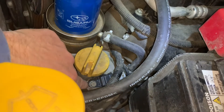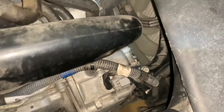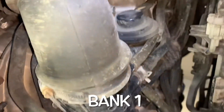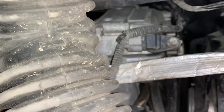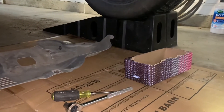The first one you'll find is on the driver's side near your oil filler cap — 10 millimeter bolt, electrical plug in the back. The second one is on the passenger side at the front of the engine — there's an electrical plug and a 10 millimeter bolt underneath. Let me grab my flashlight and crawl down onto the floor. Make sure you put down some cardboard. You'll spot it right there — 10 millimeter bolt and electrical plug, right underneath the one on top.